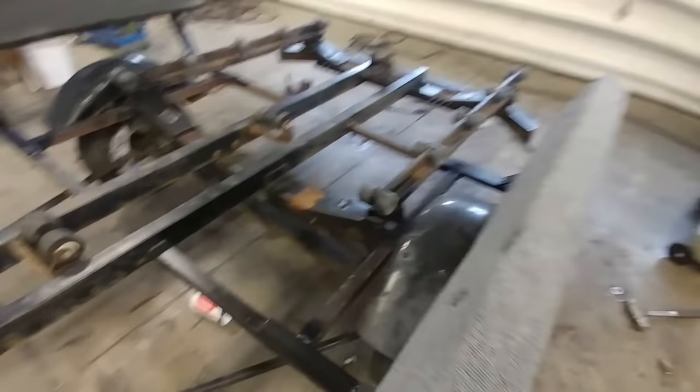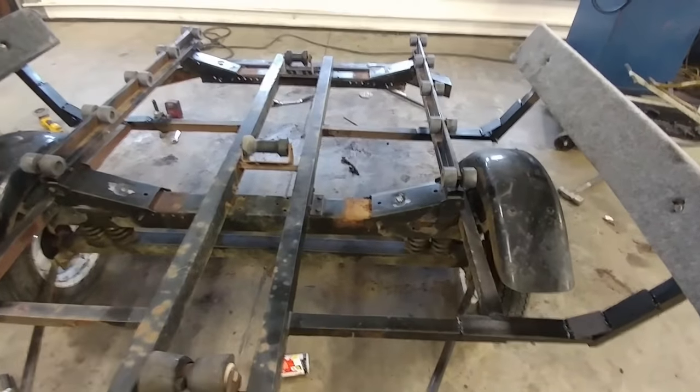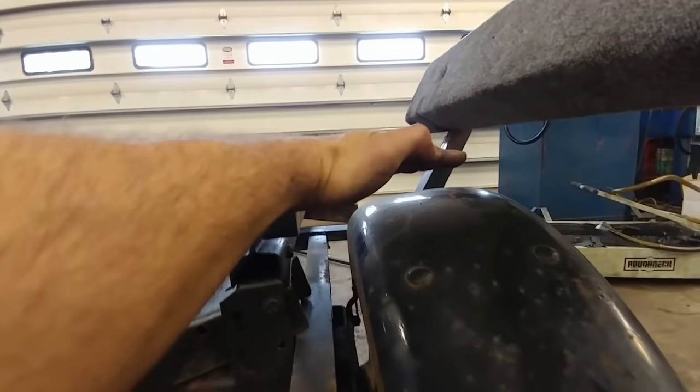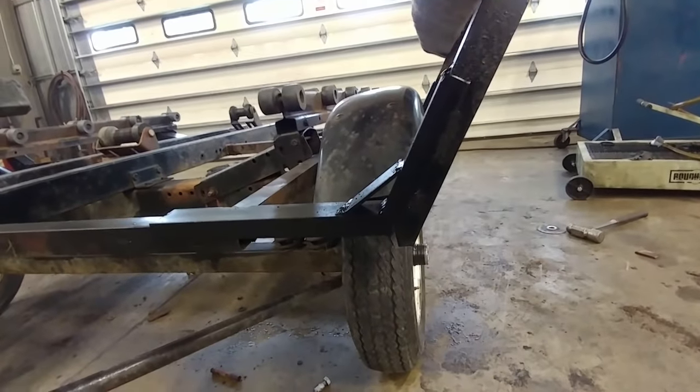What I had to do — I thought I just could crank those up, but that would have put the rollers right on top of the ribs. So I had to move them out, and of course up. So I just set this piece on top of here, and that was the height I was pretty much stuck with unless I was going to trim on that. That is about an inch and a half above the fender. And then I took some channel — it's a little bit of jankiness, but really, it's not going anywhere.